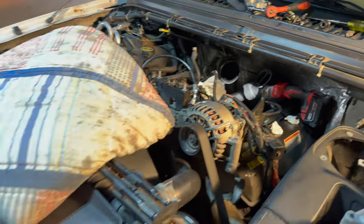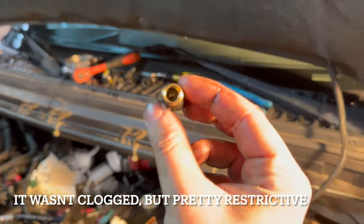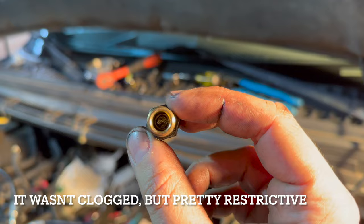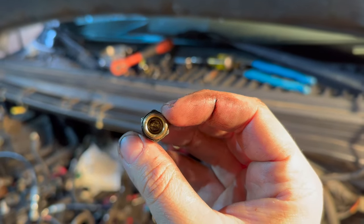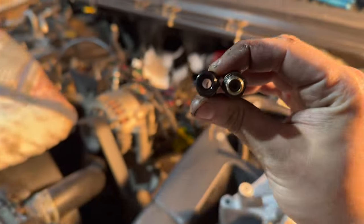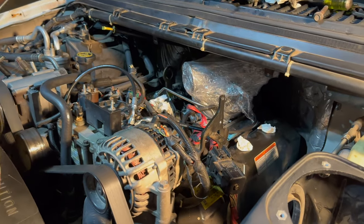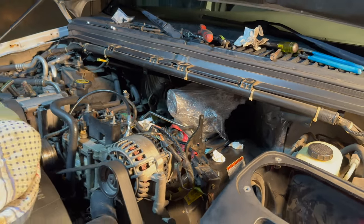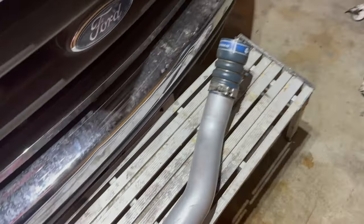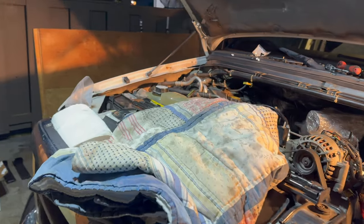Day 7 million working on the truck. I cracked the screen because it got stuck inside my socket and I had to push it out with a screwdriver, but I got the back end check valve off and I'm going to be replacing it with the new high flow unit, so there's going to be way less restriction. It's about 7pm and I got the turbo in pretty much - I just have to clock it a little bit clockwise. Tomorrow I'm going to hopefully finish installing the turbo and then it's just a matter of putting everything back on.